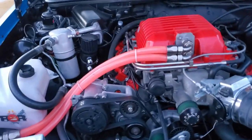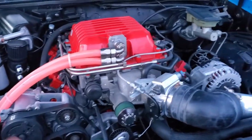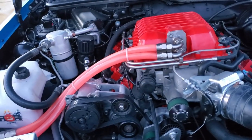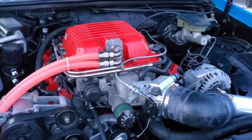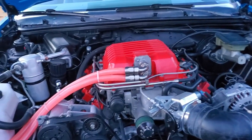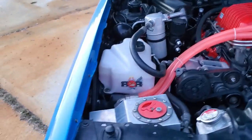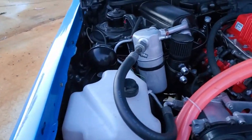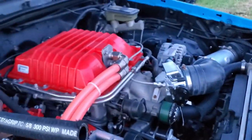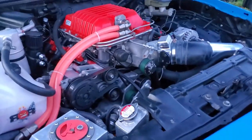Somebody tried to show me proof it was done before, but I've got the receipts. After I posted it, everybody hit me up. If you want the clear hoses, I'll put a link in the description - you can get them on Amazon or Home Depot. Just make sure they are high-heat rated, because if they're not and fluid gets hot they'll get soggy. I've seen a couple people's cars like that. I have a catch can but haven't gotten the hose routed yet - I have a one-inch hose right there, just haven't gotten around to it.